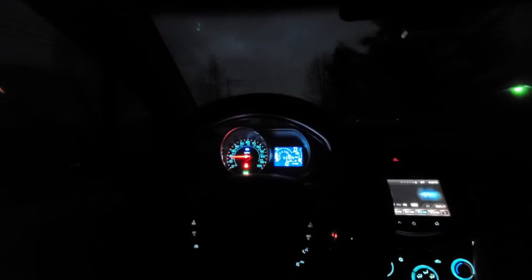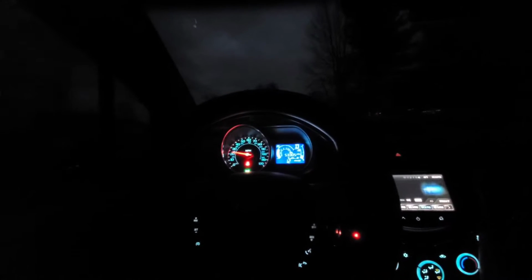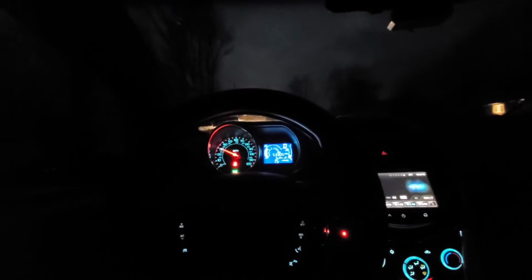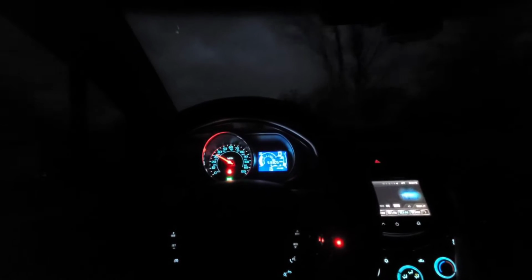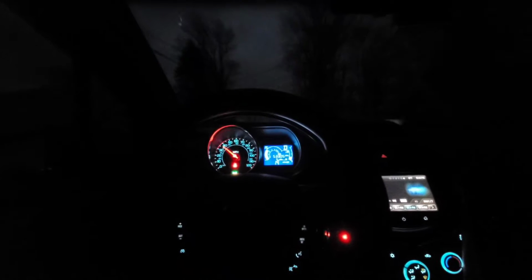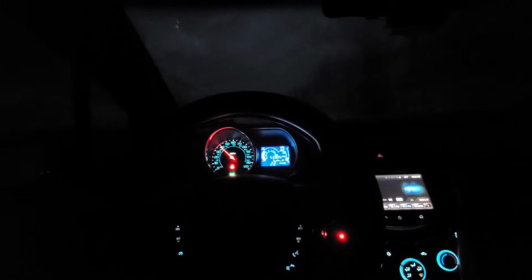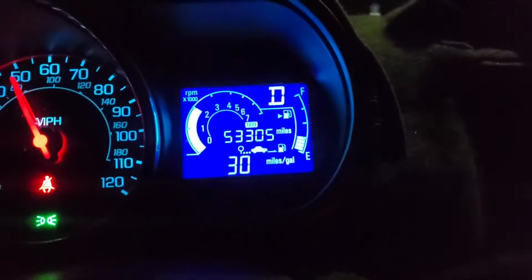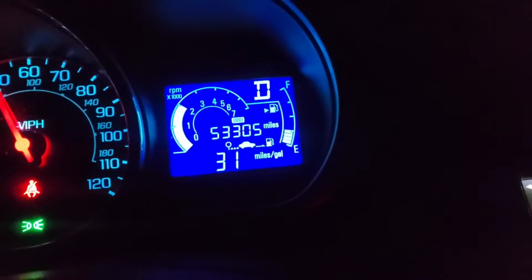Oh, right in gear. Nice. Went in at 10. I'm listening for it. There it goes. In at 35. So there's the two shifts, 10 and 35, and then it's supposed to go into lockup. The converter now locks dead solid with the engine, so it's 1-to-1, just like when you let go of the clutch on your truck. The RPM is reading 2 grand right now, if you can see it. It should eventually drop down a little bit once it goes into lockup.